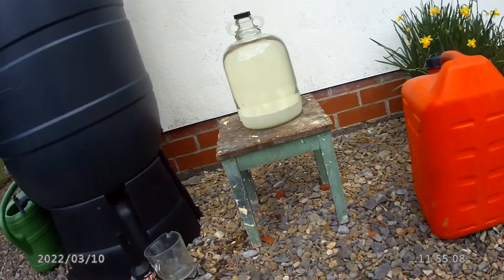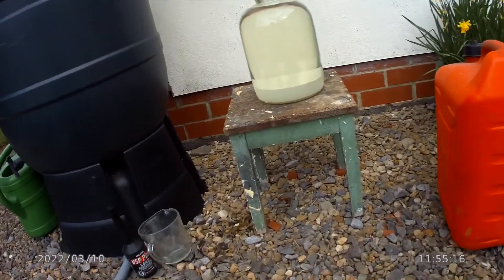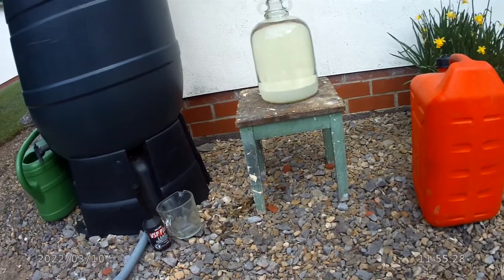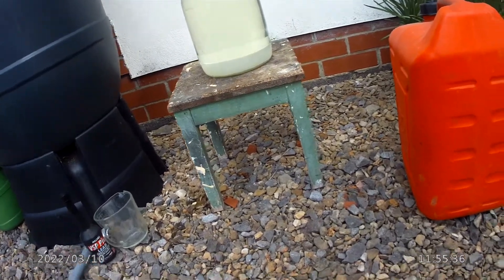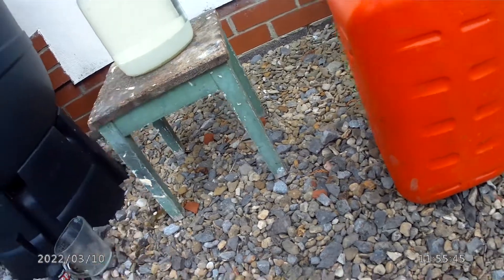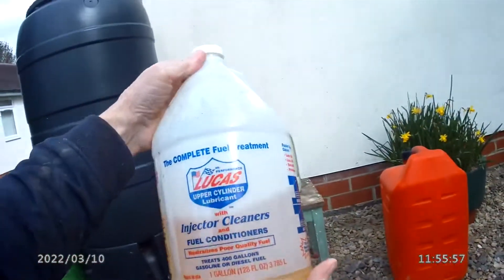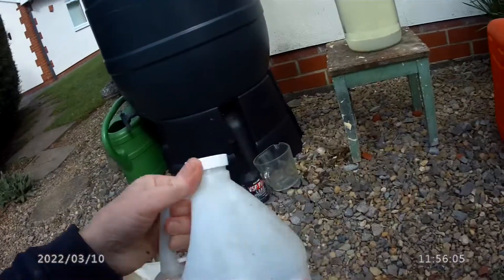Octane rating affects pinking. It doesn't really affect old cars because the compression ratios are fairly small. The other thing I've noticed doing this is that you get a white liquid at the bottom — the ethanol and water mix. I'm not sure whether the effect of doing this may have taken out some of the additives that were put in the petrol, because this white shows there's a miscible fluid that's got into this layer. So what I do — I buy this complete fuel treatment, injector cleaner and fuel conditioner in bulk, and every now and then I add a bit of that to the various vehicles.